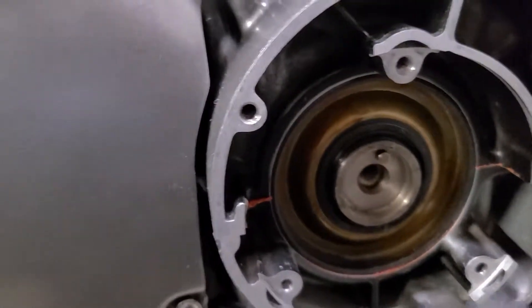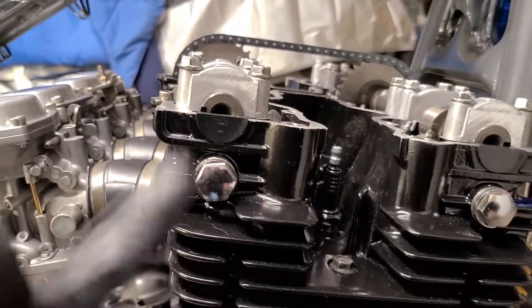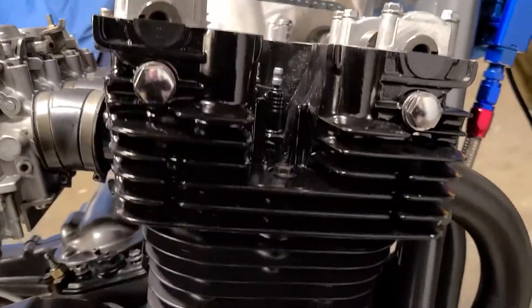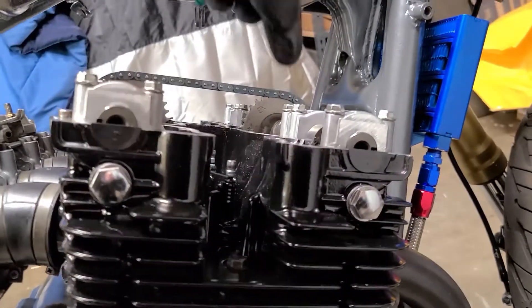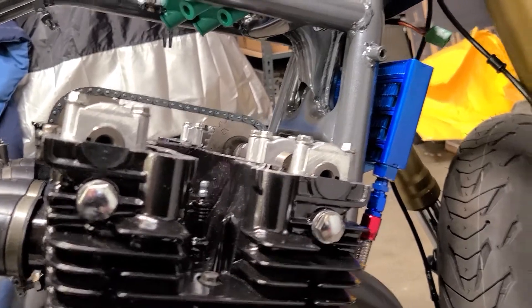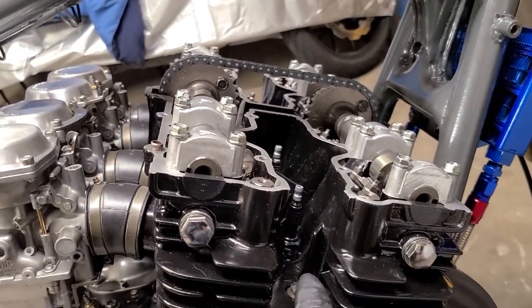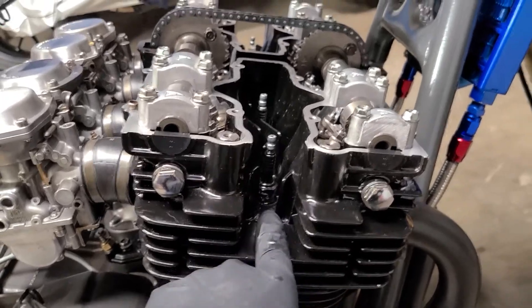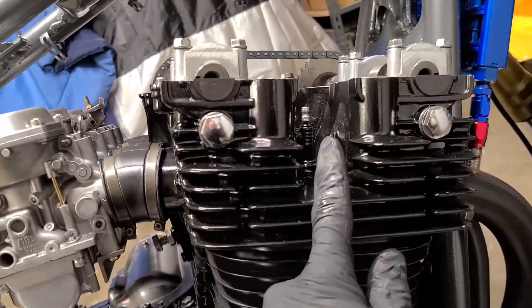You see this notch right here? This is your crank, and you want it facing straight up. The number one piston and number four has to be at TDC — top dead center. To check that, you can actually unscrew your spark plug on either side of the motor. Take a clean screwdriver and stick it down in there with a light — you can actually see the top of the piston if you've got new or cleaned pistons in there. I know I'm on top dead center right now because this is TDC for cylinders one and four, and this is facing straight up.